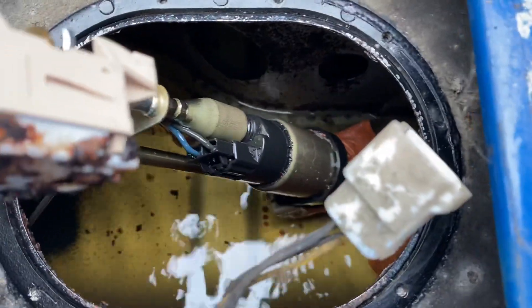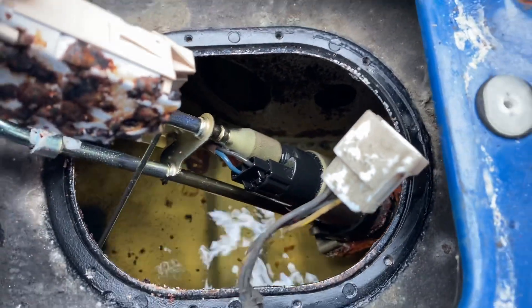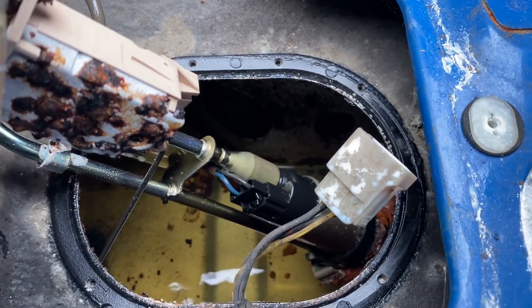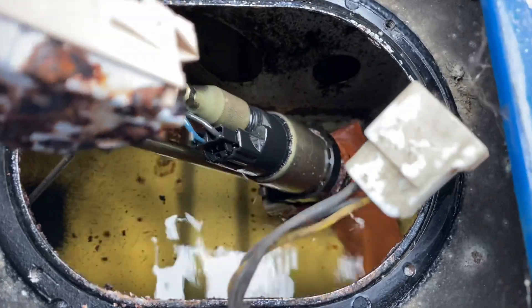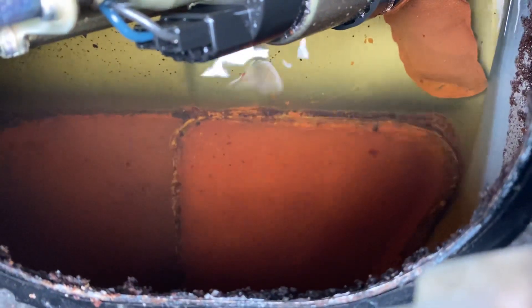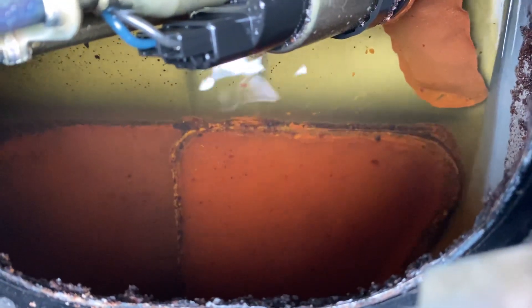In the bottom of the tank you can see a lot of stuff in there — you can just see it dribbling out of the sock on the fuel pump down into the depths of the tank. That'd be why this thing doesn't run for sure. You'd definitely want to replace the whole assembly here, or you might get away with just replacing the fuel pump and cleaning up the tank. But you can just see all that in the bottom of the tank — it just doesn't look good.